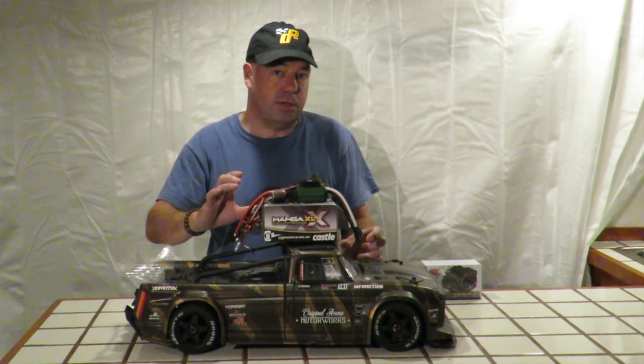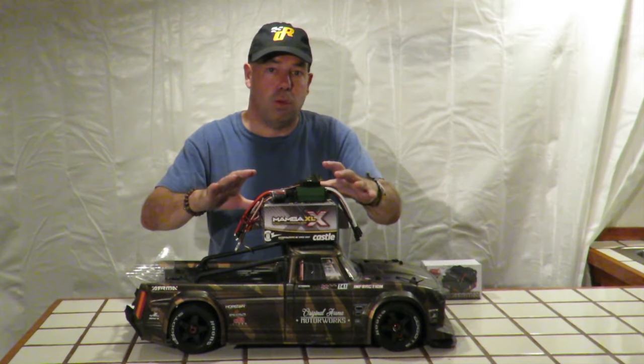What I would recommend is immediately fitting a Castle XLX ESC. This ESC will take 400 amps versus 150–160 on the stock unit. This means on 6S, this thing will run all day long — you can donut it, do high speed runs, and it's not going to overheat at all. There is also one huge advantage: it takes up to 8S power, so you can fit an 8S motor, up the gearing, up the speed, and up the whole performance of the car.